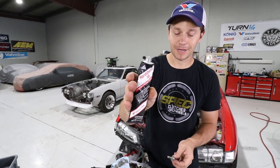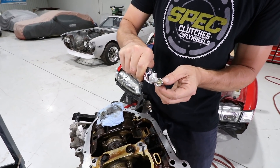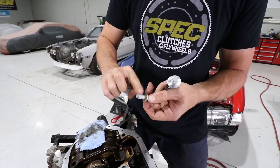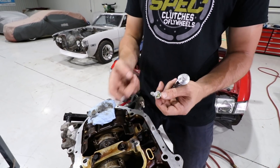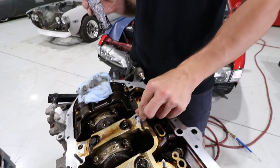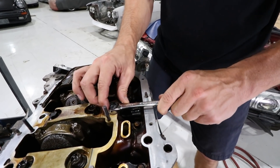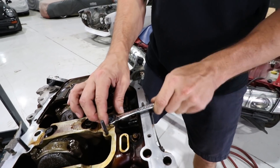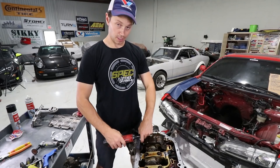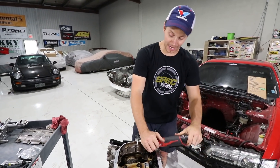Got the Honda Bond again — it's coming in handy. Put just enough on this bolt, which I think is an M8. If you've got a different K24, this may not be threaded, so you might have to actually tap it. Eric from Levine Motorsports was saying if you don't plug that, your motor will go kaboom in a hurry. Going with the classic good-and-tight torque spec. I don't want to go too tight into aluminum. Key here is not to drop the bolt into the engine — that's really the only tip I have for you.